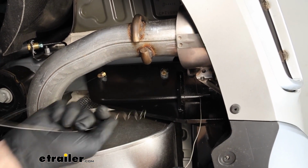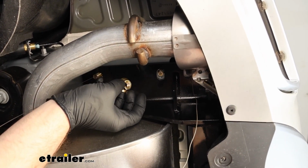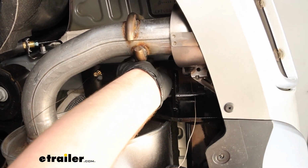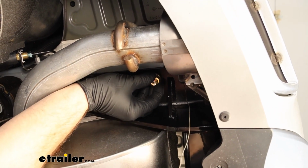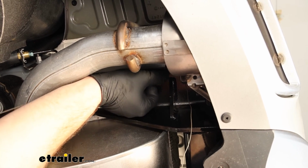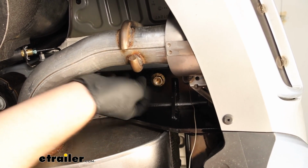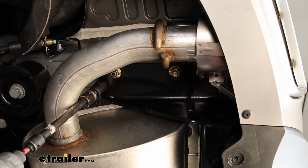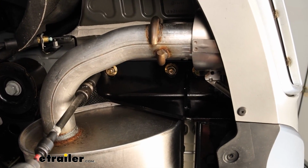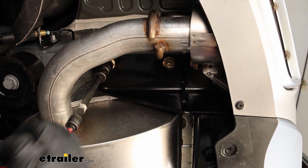You can remove one of the fish wires, and you're going to take a flange nut. You want to get at least one of them started hand tight on each side. That way the hitch will support itself while we work on the rest of them. Once you have all the hardware in place and hand tight, we'll come back with an 11/16 size socket and snug it all down.